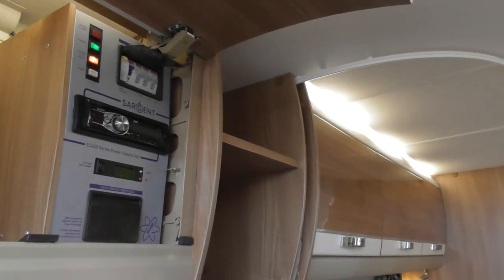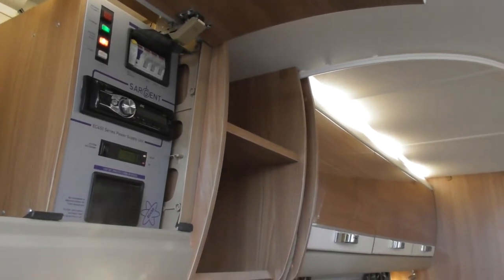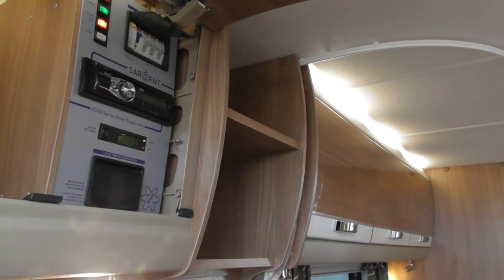There's also the system shutdown button in the middle. If you ever leave your van for any period of time, hit the system shutdown button — it isolates any drain off your 12-volt system. When you come back, just knock the black switch back on and power the van back up. Use it when you're leaving the van in storage — it saves the drain off your leisure battery.